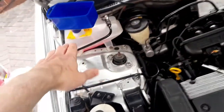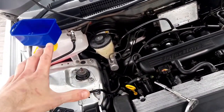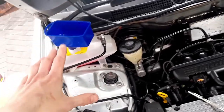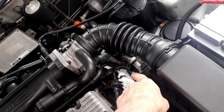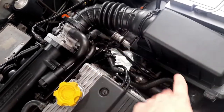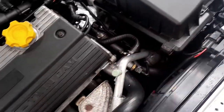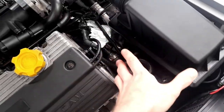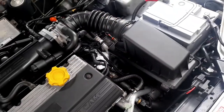And the fluid level stopped up there, didn't it, just a few minutes ago. But it slowly worked its way down because of air bubbles. But then it stopped again. And it basically stayed stopped until the point where I pulled that bleed nipple. And what's happened there is all the air that was trapped around these hoses and the radiator in this side of the system, all that air has now been purged straight out there, straight out.